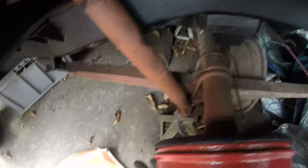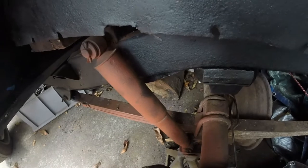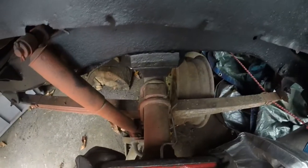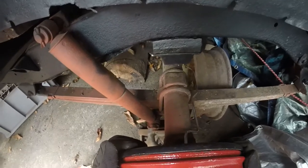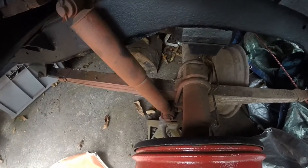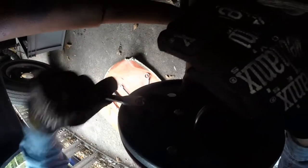We're going to start at the forward edge, top forward edge, and adjust this one. Then we'll do the trailing front or trailing top one, and then we'll go on the bottom, do the bottom leading and then the bottom trailing. So you need your 9/16 wrench here, and I'm gonna kind of look in here and just gonna loosen.